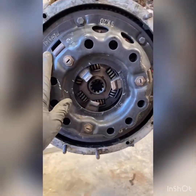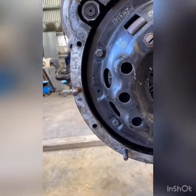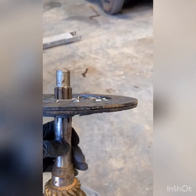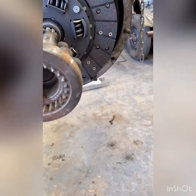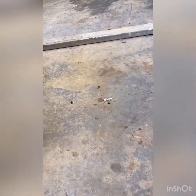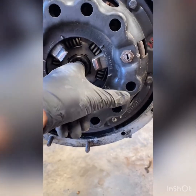Same with the clutch and the pressure plate — best to change both if you can. What I do when I'm refitting them is use just the output shaft of a gearbox as a positioner, so you can slide that in the hole with the pressure plate around it and bolt that up. That way it's in the perfect position. If not, you can use things like a socket and put a socket in here — just keep everything lined up.